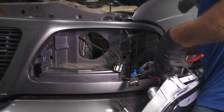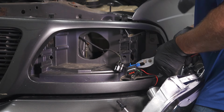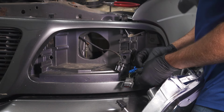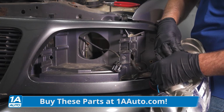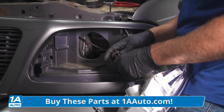Because the vehicle prior did not have daytime running lights, we have to splice in two wires into the side marker indicator lights. And you can do that with the connectors provided. Plug in the bulbs. Then we'll plug in the main wiring connector